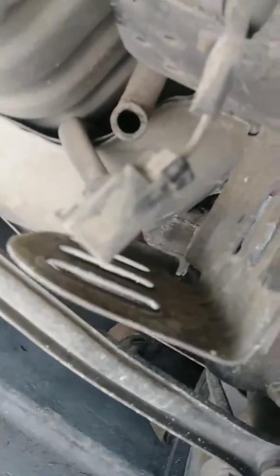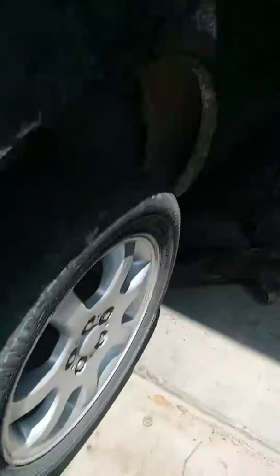This is the top part of it. For those of you wondering where the location of this item is, it's right down there. That's the plug-in for it. And then the vent hose, which is the filter and the one that goes to the tank. Now that hose runs all the way back up to the front of the car over here to the purge solenoid, which is located right down.